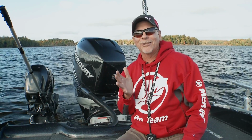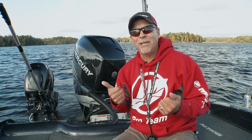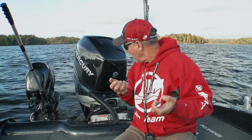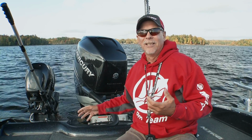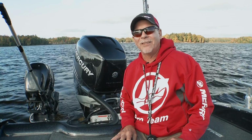I remember one day that I was going wide open across the lake and I hit a rotten log. The log didn't hurt the lower unit. It kind of broke up in a bunch of pieces, but it packed a bunch of wood particles into my water intake. And I turned around and I looked and my telltale kind of went from being strong down to nothing. So I basically idled really slow back to the dock and had to unpack all those wood particles out of that intake. So it's an indication for a healthy engine.